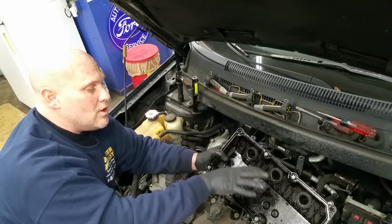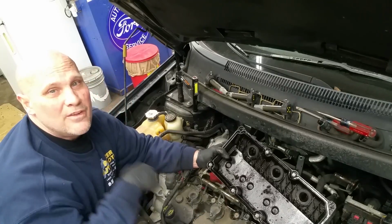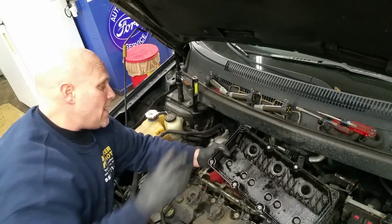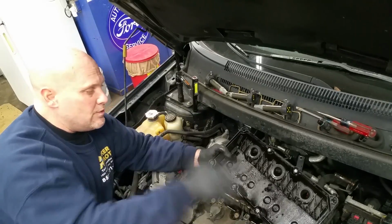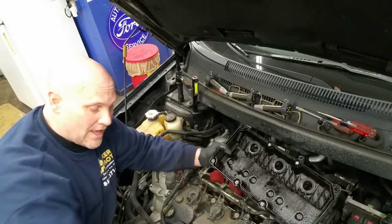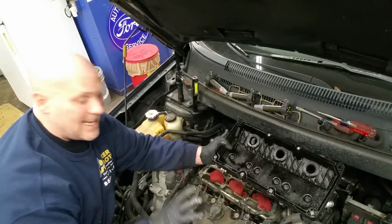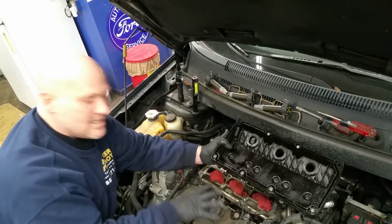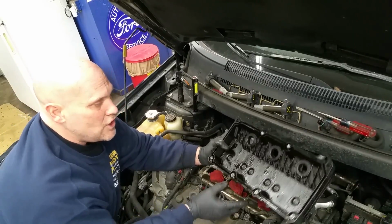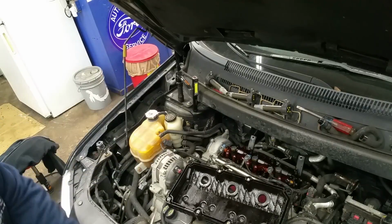This isn't caused by combustion leaking. I mean, part of it is, but your vehicle will never not have combustion leaking through the seals into the valve cover or into the crankcase. That's what a PCV valve is for. That's what these vents are for, to vent all the spent gases and carbon monoxide inside of your motor. So logic tells you that if you don't change your oil when you're supposed to, this is what happens.